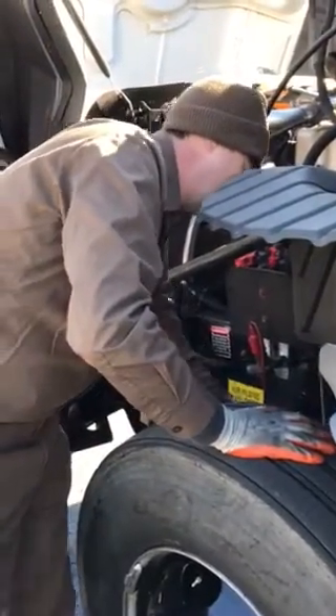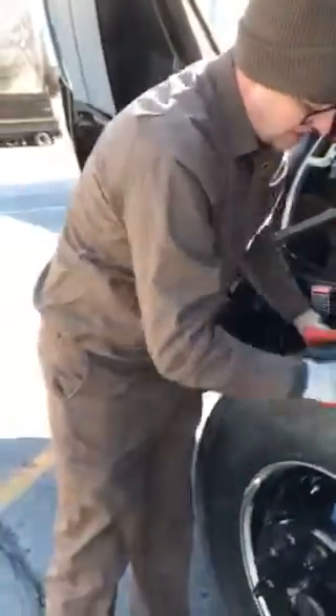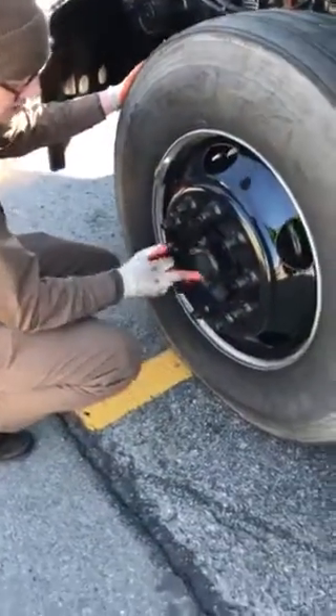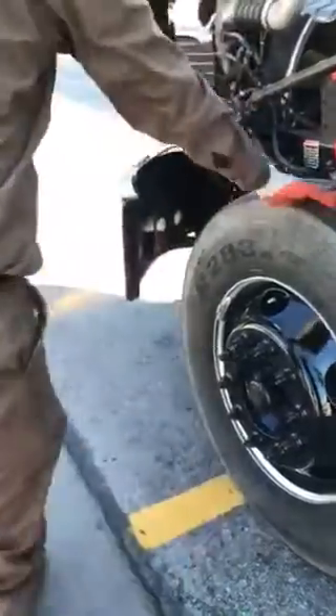Brake chamber and air line — securely mounted with no leaks. Brake lining — minimum quarter inch thickness, no cracks or contaminants. Tire has a minimum 4/32nds tread depth, no uneven tread wear. The inside and outside of this tire — no cuts, abrasions, bulges, or exposed cords or fabrics. Wheel has no rust or cracks, no missing or loose lug nuts. Lubricant level is between the high and the low. Metal valve stem and cap. Visual check on inflation — put my shoe here, pull on it, checking for a worn wheel bearing.